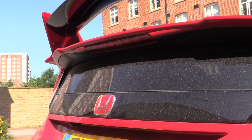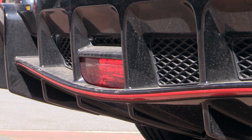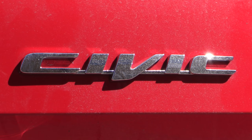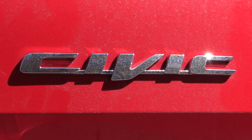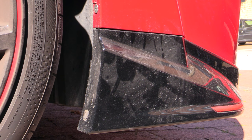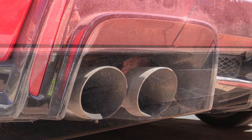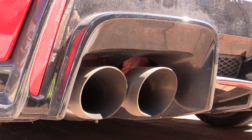Although at a glance the new Type R looked clean and presentable, upon closer inspection its various aggressively styled surfaces were covered in a light layer of summer soiling which needed safely removing without the use of the usual suds, hose pipe or pressure washer. The car had also recently returned from a trip to the body shop where its previously detailed Milano red paintwork had been treated to a complimentary swirly wash, so not wanting to inflict any more imperfections, I turned to one of the few proven products safe to use in these unfavourable conditions - Optimum No Rinse.